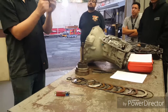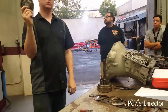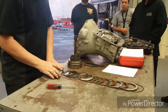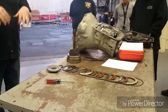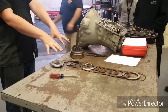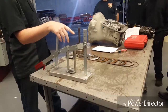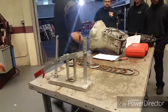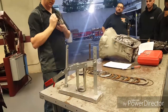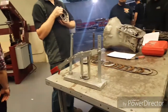So we're going to pull them all out. And the last thing — look at that — that's my little check ball in here. That's what stops centrifugal force from reapplying the clutch by accident. So here's what I want you to do on this first step: take some more time to look more closely at the parts. Tear your clutch down until it matches mine perfectly on this table. Some of our transmissions require this press; I actually have a couple where we don't need it. You're going to find your set might be different — you may have a much larger central piece and may not have one spring.